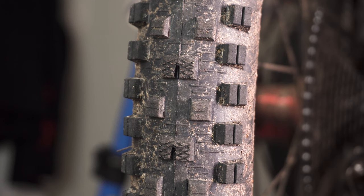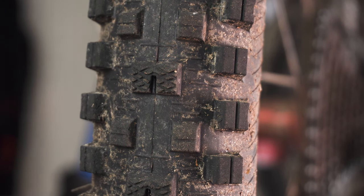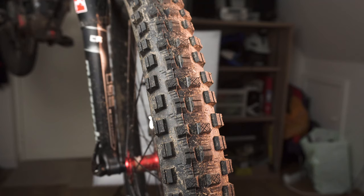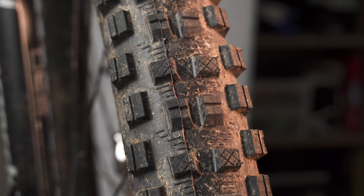The Singletrack features an alternating knob pattern and siping, and I think that alternating pattern is what's giving it a major issue in the wet — because one of those alternating patterns doesn't grip in the same way as the other, which is why it's sliding out and catching itself, and sometimes not catching itself. The Gripper is also slightly alternating, but not nearly as much, and I've never had any issues with it in wet or dry. It just works like a good tyre should — you don't have to think about it, you just go.